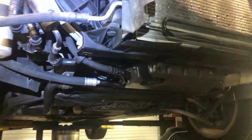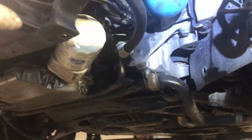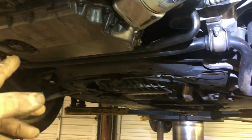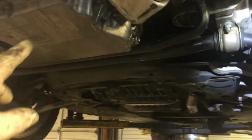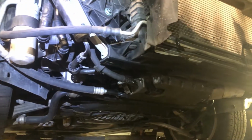All right, everything's hooked up. Really not much to do anymore. I'm gonna pull a vacuum and put the battery on charge, top it off with oil. I drained most of the oil out. I'm not gonna change the oil just yet. I'm gonna change it after I get it running and hot. But I had a little bit of coolant from pulling the heads off, so I drained all that out. I'm gonna top it off with some fresh oil and get it running and make sure nothing's leaking, make sure it's running right. And then at that point, I can put the bubble cover on.